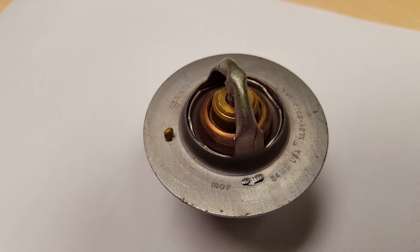Now your SN95 may not trigger a check engine light, but rest assured that if it's going in and out of closed loop as you're driving, it is not doing you any favors for driving enjoyment or fuel economy. So what's the best thermostat to run? I run and recommend a 180-degree Fahrenheit thermostat — it's a really good all-around fit. It will get your engine coolant temps down and allow the system to work more efficiently. However, a 170-degree thermostat in certain climates may be the right choice. What you want to avoid is having an engine that over-cools and dips below that 160-degree Fahrenheit threshold, because a 160-degree thermostat or no thermostat at all is going to over-cool.